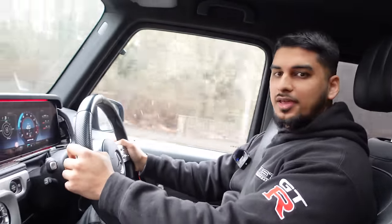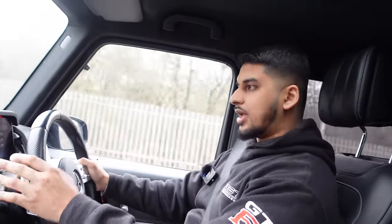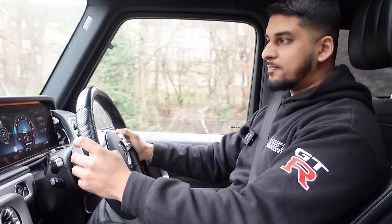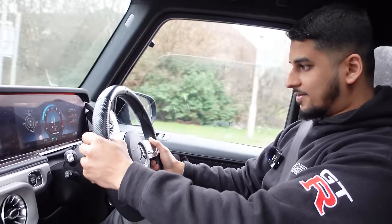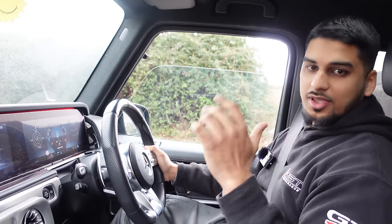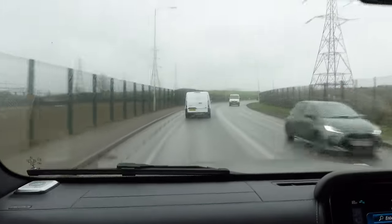What's happening people? Today is Monday and we are back data logging the G63 AMG. I'm going to finalize the tune today. The process is: put a base file onto the ECU on Stage 2, log the car on the road, make sure everything is looking spot on, then fine tune it and get the figures right. Just want to let you know — we've just made this the baddest G63 in the UK, possibly in the world. That's just on a base Stage 2 file — I've got a lot more fine tuning to do. The crackle and pop sounds insane. I wouldn't be surprised if the car is flaming from the back.